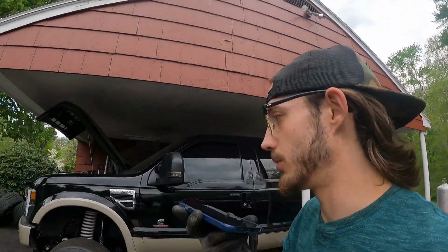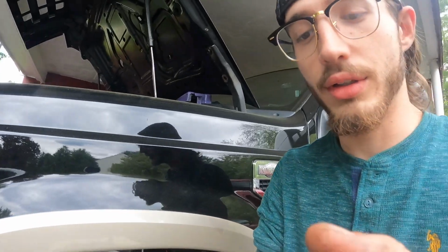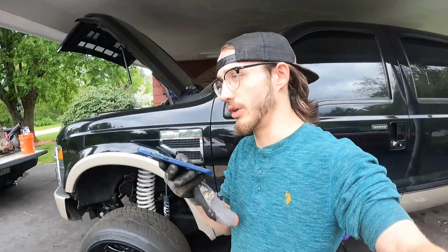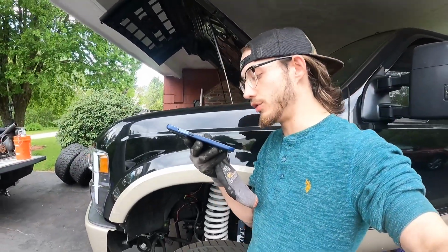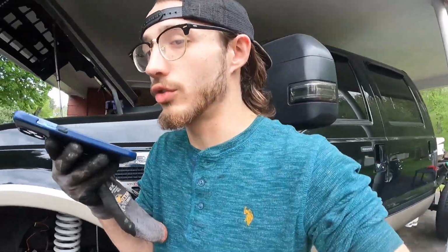a ton of reading, because I posted some questions in group chats on Facebook, and people are like, no, your thinking is backwards, your engine is sooting itself out. People were like, your low stall speed seems logical, because I was like, do I need a low stall converter? And everyone was saying, no, you can use the factory Ford converter, it's fine. And I'm like, I don't know, I'm having massive issues. And people are like, well, the diesel governor will respond to low stall and just governor up the engine to maintain normal RPM. And that's sort of what was happening.